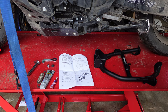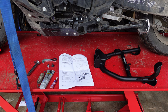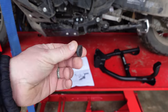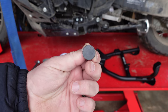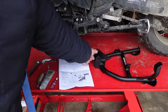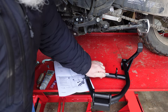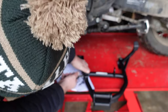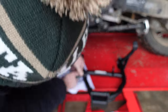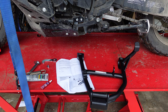This just pops in. The hardest part here should be stretching that spring, which I'm not looking forward to — doubly so in the cold. But the first step is to install this rubber stopper on the upper side of the center stand to keep it from banging into the frame. I'm a little concerned it's going to be stiff because it's so cold, but I kept it in my pocket. I just got to grab underneath and pull it through. Ta-da! Wow, that was shockingly easy.